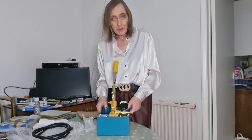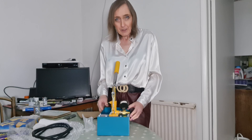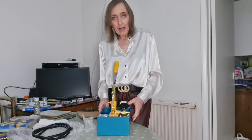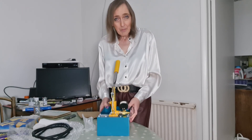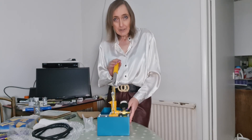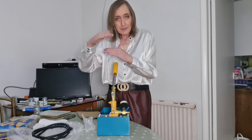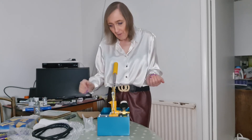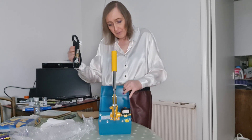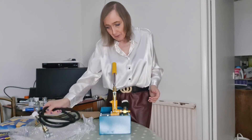This is actually a pump for my hydro-gas suspension, or hydro-elastic suspension if you've got a Mini. This is for the British Leyland cars, like the Metro and other cars like the Austin Princess and the Maxi. I've got a Midas kit car which is based on an Austin Metro, and of course the fluid in the suspension comes out eventually — the wheels get closer to the wheel arch, the car sinks down on the suspension. This will allow me to put fluid in this tray and pump it through to pump the suspension up.